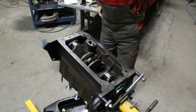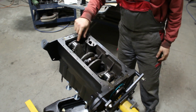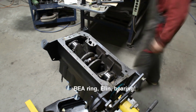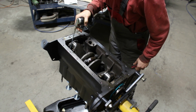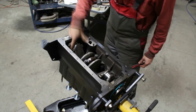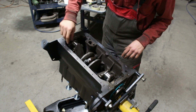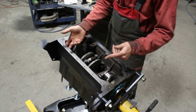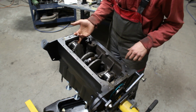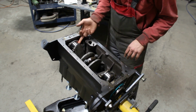the masking tape. Now before I put the cap on, I'm gonna fill the connecting rod with oil through the hole on the ring. Please, it's very important when you assemble it to put oil everywhere, because if you don't, the first couple of turns, first couple of hundred turns on the engine, everything is gonna be dry, and I don't wanna think what can happen. So all the parts, put a lot of oil.